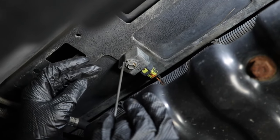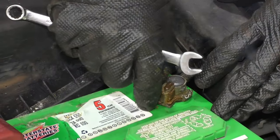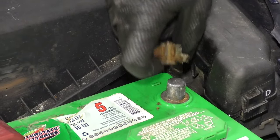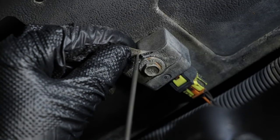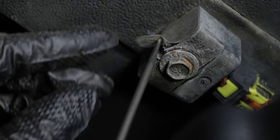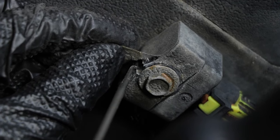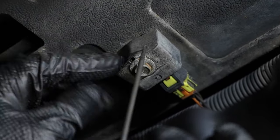Some will be attached to the rail right here — you just got to pull this shield down. A lot of times you get corrosion inside the sensor, and you want to make sure you disconnect the battery whenever you're dealing with the sensor. So disconnect the negative terminal, and you can see there's actually corrosion in here, and the sensor itself has actually split open. This sensor is bad.